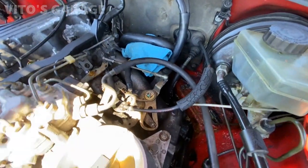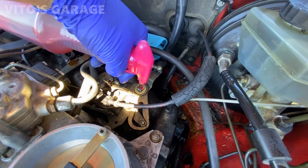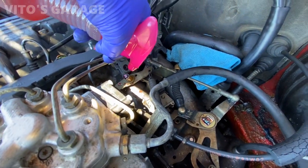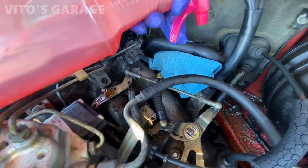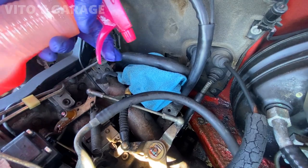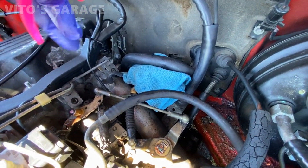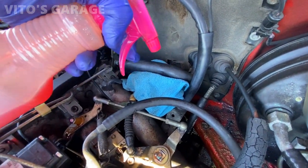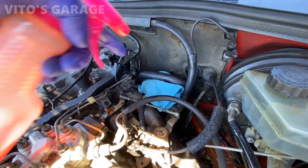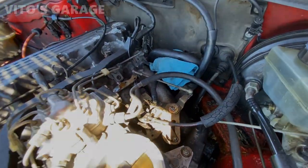While I'm here, I'll lubricate all these bushings with automatic transmission fluid. And then I have this rag right there, just so this coolant hose doesn't rub through the oil filter and start leaking. And this is just temporary. Like I said, I have the heater core bypassed right now. That's why it's like that. As soon as I fix it, this rag will not be there anymore.